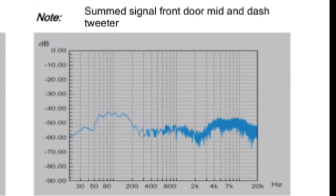Another thing you could do is get a processor like the Bit 10 or Bit 1. That will actually flatten out that factory EQ curve — you just go in there and it flattens it, giving you basically a straight flat frequency response. Then you can use that Bit 1 or Bit 10 to actually equalize the speakers. What's happening is the factory EQ curve was meant for the factory speakers, obviously, and the aftermarket speakers you're installing are going to require different EQ curves. So you can use some kind of processor, flatten that factory EQ curve out, and then EQ the speakers from there — that way they'll sound a lot better with their own EQ curve.